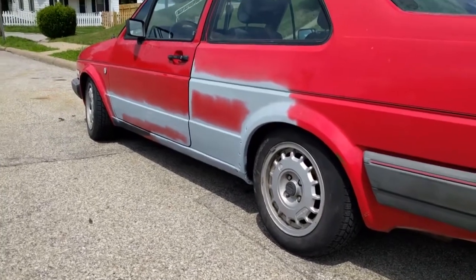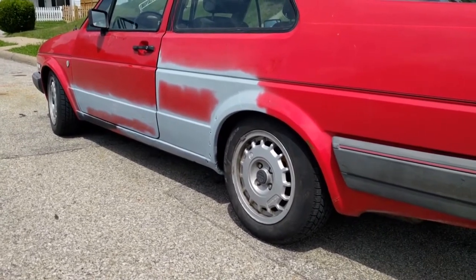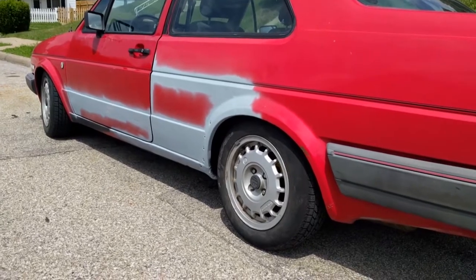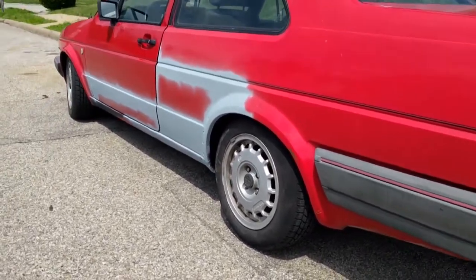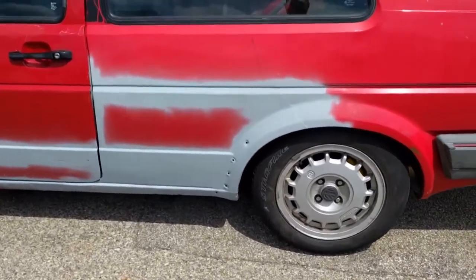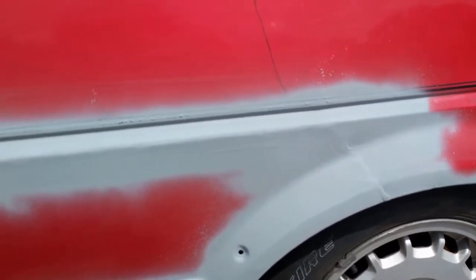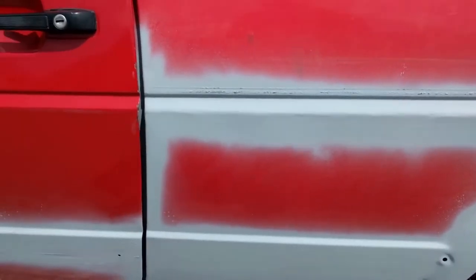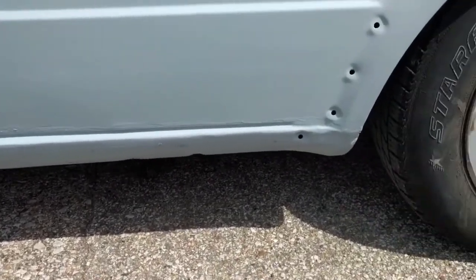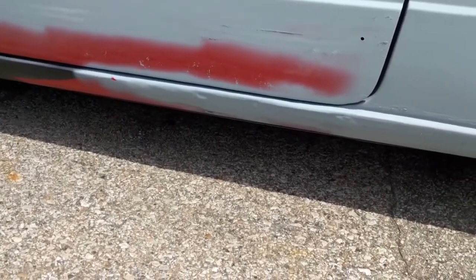And here we see close to the finished product. Did all the spot welding and used a grinder and then a sandpaper flapper wheel. Kind of smoothed everything out. And you can see just a little bit of where I was welding. There's a little bead along there, but the body line's pretty smooth. There's the bottom weld. It's a little wavery kind of up in this area here.